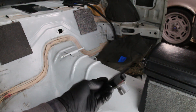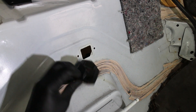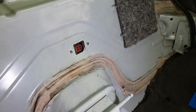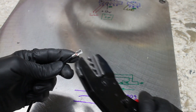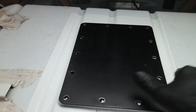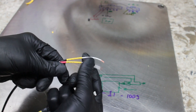This bulkhead allows you to use a sealed plug to easily unplug the fuel pump for maintenance or whatever. The 3D printed bulkhead mount is screwed in from behind, then the plug is screwed in from underneath the car. The PSI kit comes with a terminal that secures itself to the fuel pump relay. The 12 gauge feed wire and two fuel level sending wires are shown for my Aeromotive gas tank.